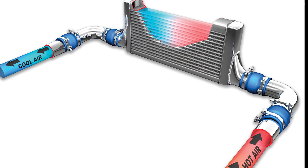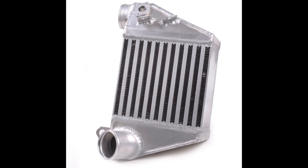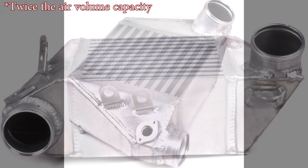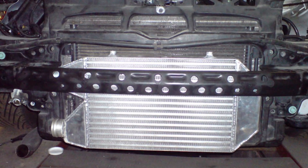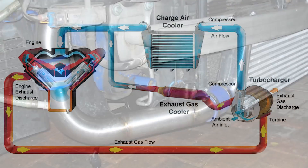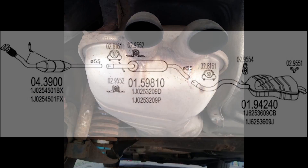Now we've got more fuel and more air going in, we need to cool that extra air down. The stock intercooler on my car is tiny and in a fairly tucked-up place. There are two options: for my car there is actually an uprated side-mounted intercooler I can bolt straight in without changing any piping or fittings, which has twice the volume of the stock unit. Alternatively, you can go for a front-mounted intercooler placed directly in the airflow for maximum cold air — and cold, dense air means more power.